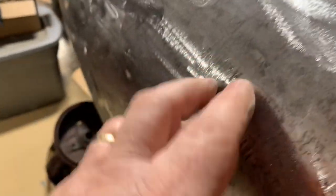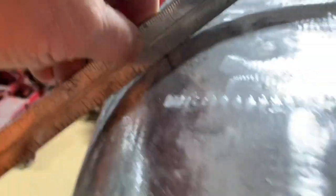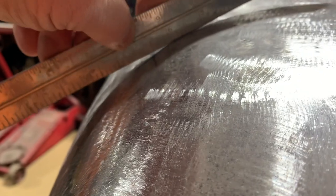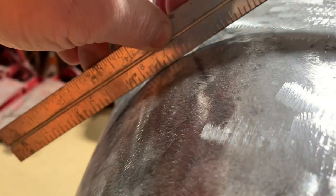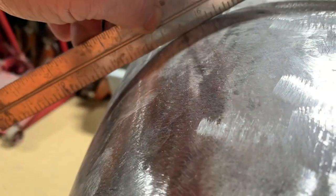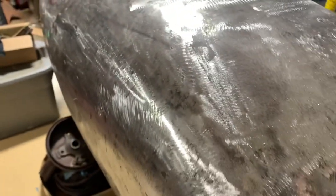You can see there are some dents that I've still got circled that I haven't done yet. And this long crease right here — I've dollied it out most of the way. Unfortunately, it had a big, big divot in it and it has a straight edge. Well, a straight edge isn't going to work really good on a curved surface. But you can see that you can almost not see any light underneath it when it rolls. So we're close. I can still feel a little bit, but anyway, just going to bring you up to speed on this truck.